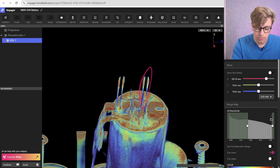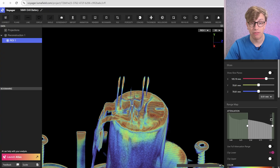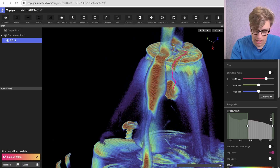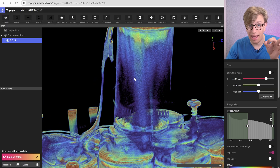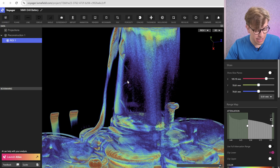This terminal just goes directly onto the battery cell beneath it. Our secret third terminal — things become shockingly hazy in this scan, and I think that's because nickel is a fairly heavy element compared to lithium. So our secret third terminal kind of disappears, because it's actually soldered right onto this tiny little wire, which disappears into a shadow and then ducks down into a pocket right in the middle.